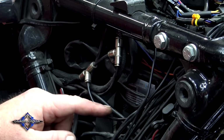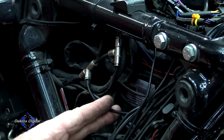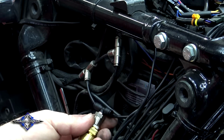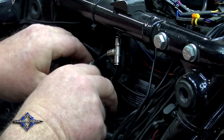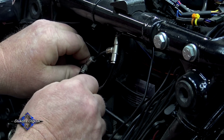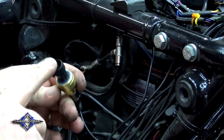So you just come over here to your airline, come back off the existing T, cut right in here, and then you would just take this new T and put it right in that cut. So now you've got a complete connection. But if you have an extra piece of 5/32 laying around, it's very simple. Just disconnect it. One's gonna go into one side, one's gonna go into the other, and then we're gonna connect it here. And now we have a complete connection again, and this is where our wire is gonna go up